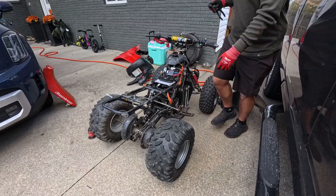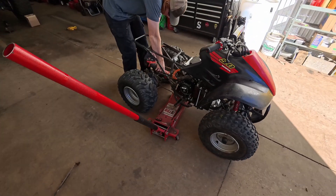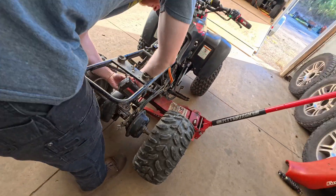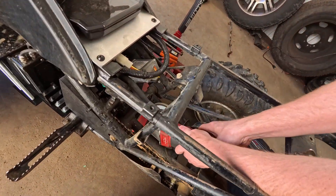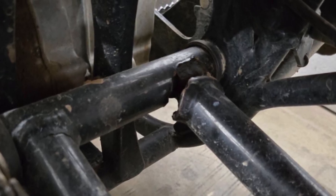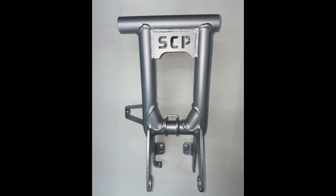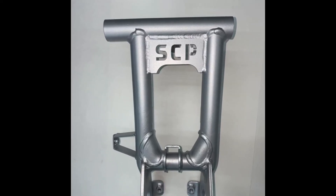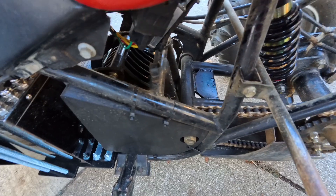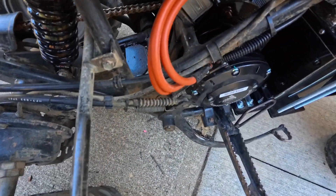Since I never actually fit the battery onto the bike before fitting the plastics back on, I only had to trim maybe a quarter inch off each of the inner fenders on each side — so I was really happy with that. It only took about five minutes. After getting the front plastics on, I circled back to Drew's a couple days later because I forgot a crucial component: I'm putting a gusset in the rear swing arm. These are notorious for breaking — I'm an adult riding a kid's quad. You can see on the right side here one broke off; I found this in a Facebook group I'm in, and it's seen on many TRX 90 swing arms across different years. I made my own gusset, Drew welded it in, and it came out really nice. I just painted it black with a spray can — I wasn't trying to powder coat it or take everything back apart, since it's going to get beat up anyway.